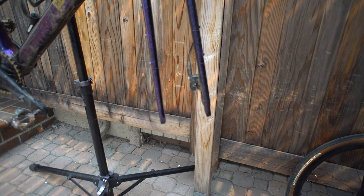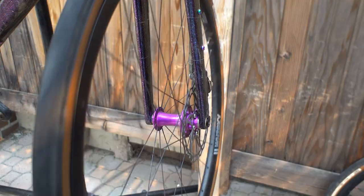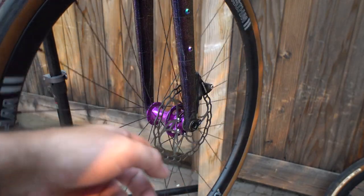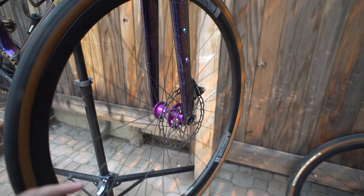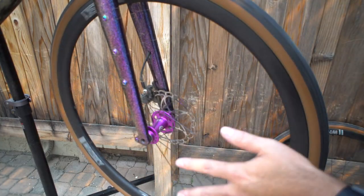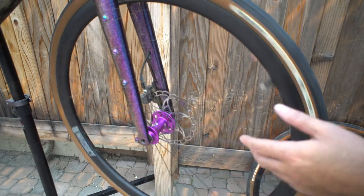Let's find out if the third shim was the trick — and it looks like we have success! There's a tiny bit of rotor rub but only at one point in the rotation, meaning there's a slight warp I can hand-bend back with no problem, especially with these lightweight weight weenie rotors. The rotor now spins nice and freely, doesn't rub anywhere on the caliper, and the wheel rolls basically forever. That's essentially all you need to do to align your wheel — I only showed the front, but you apply the same principles to the rear.